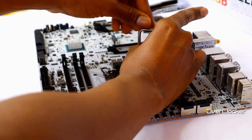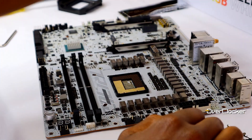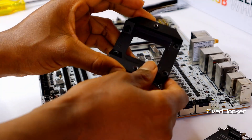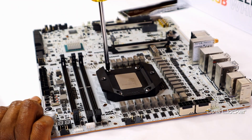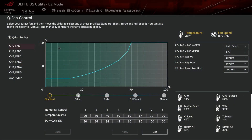That being said, straightforward installation doesn't mean it is without dangers, because you need to remove the default mounting mechanism on Intel boards, which briefly exposes the board to risk that would otherwise not exist with a more traditional mounting mechanism. Extra care has to be taken here or it could all end in tears. You'll also notice that the RGB and fan performance is controlled by the motherboard software, as Arctic has no software of their own. I actually prefer this as it simplifies things and that saving of cost translates into the low price of the cooler for us end users.